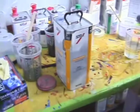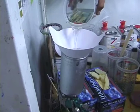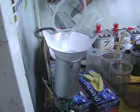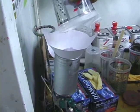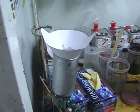Andy's grabbing a filter now because we don't want any junk in our clear coat coming through the gun. He's probably mixed about twenty percent more clear coat than we need. If you mix a little too much, you end up throwing some away. If you mix a little too little, you end up ruining your job.